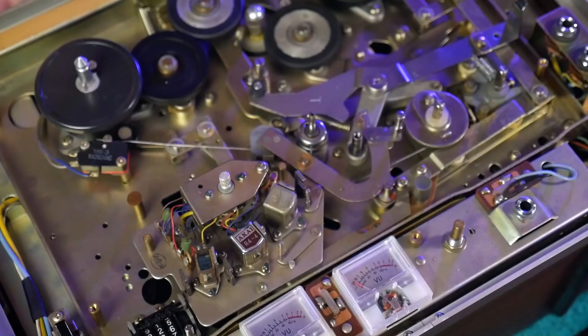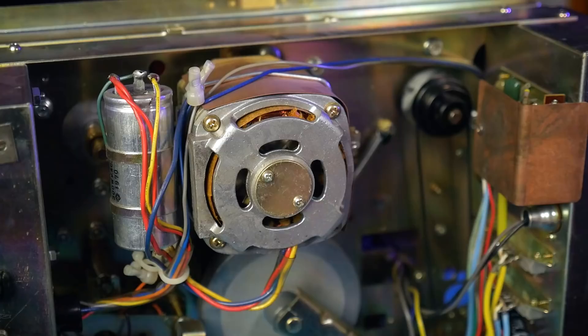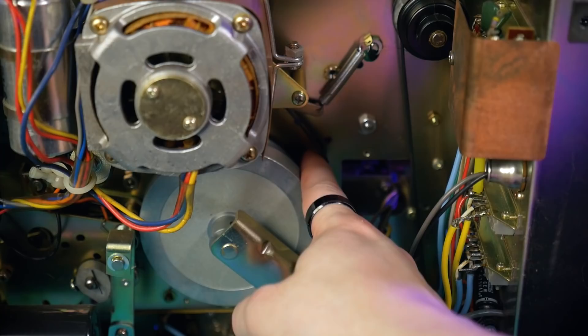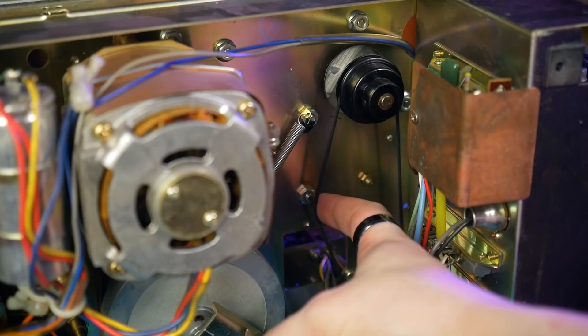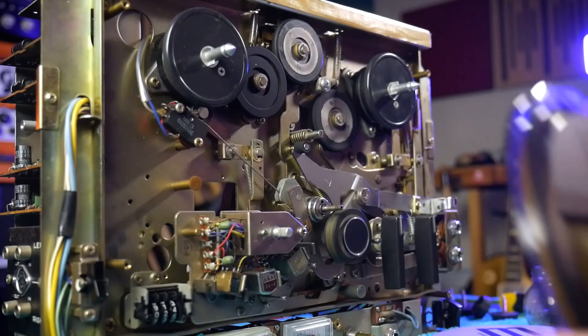This was designed in an era when electronic devices were expected to be serviced, so all of the insides are made to be readily accessible by a qualified technician. It's a marvel of engineering that such a complex arrangement of moving parts and electronics can fit inside a box as compact as this. The main motor spins a flywheel via belt drive, and a second belt connects a supply reel to the tape counter. These belts are still in pretty good condition and fortunately haven't disintegrated or melted into a weird slurry over time, as often happens with rubber belts in these devices.